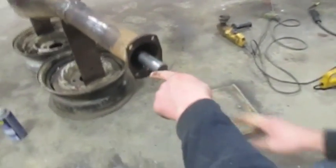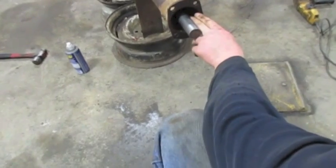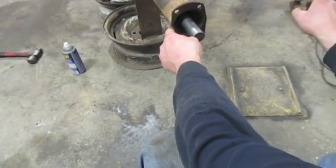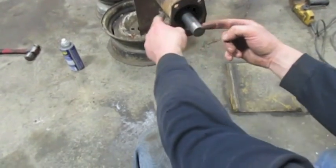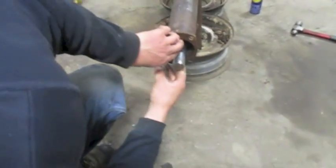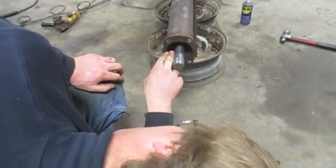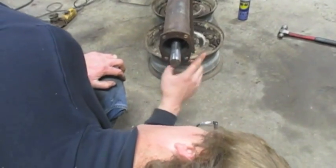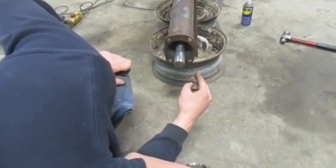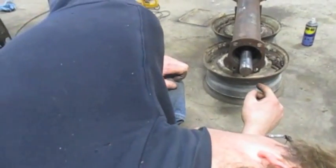There are my bars through there, and as you can see it's bent. You can see the tightness of my fingers on this side versus this side — the tubes are bent down, so I need to pull those tubes up. Coming around to the other side, they're both straight as far as front to back in the vehicle. This one's also bent the same way as the other one, so I need both these tubes to go up. This one isn't too bad; the other side maybe has to go up about an eighth of an inch or so.